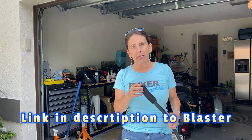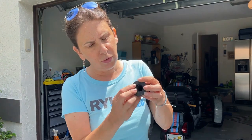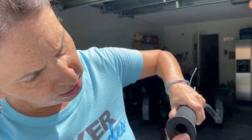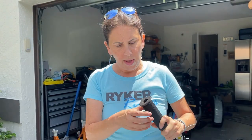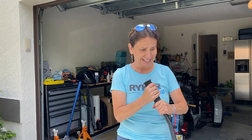You've got one remaining piece to take off to make this job super easy — the left side handlebar grip. It does not come off easily, it's a real pain. There is a blaster spray that I'll put the picture up for — I'll show you what is recommended and what people have had success with. But the easiest way I think is if you have an air compressor. You get in between there, blow it up, and it pops right off. I'll show you how to do it with an air compressor, but that blasting spray lubes it up and slides it off too.